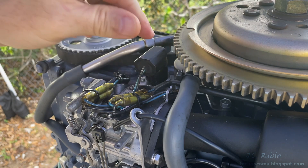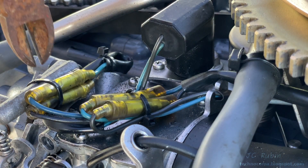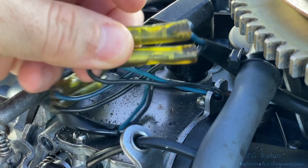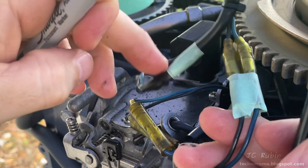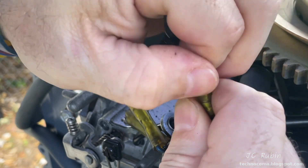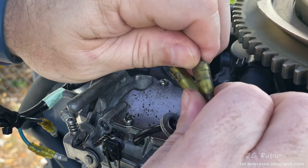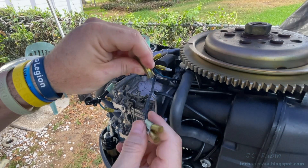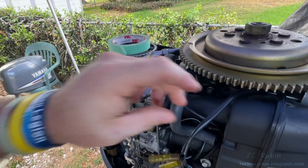As previously mentioned, these warm-up valves are connected to carbs 1 and 2 via electrical cables, and we're going to remove the cable ties they're connected to. As I unravel these cables coming from the rear of the engine, we can see they're daisy-chained going to both. I've put tape on the cables going to carb 1 and labeled them as 1 to make sure they go back where they came from. I'll disconnect the cables to carb 1 and put them off to the side, and pull out the carb 2 cables. The main cable goes back to the engine with a connector back there, but we're not going to disconnect it from that connector — we'll just pull it back and let it hang.